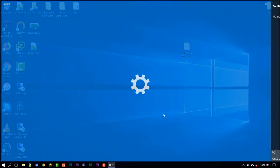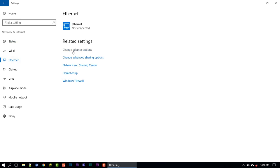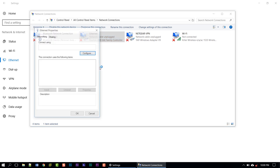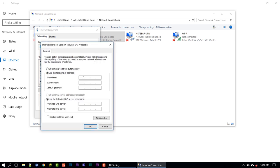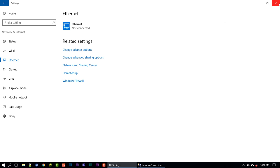We're going to click on Notification Center, then All Settings, Network and Internet, Ethernet, then Change Adapter Options. Locate our ethernet adapter, right-click, go to Properties, then double-click on TCP/IPv4. We're going to set the following IP address: 192.168.1.253 — the switch is 254. Hit Tab and the subnet mask will be 255.255.255.0. You don't need to give it a gateway. Click OK.